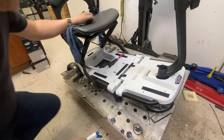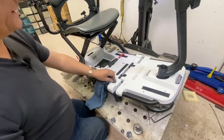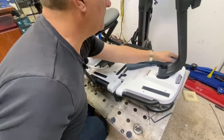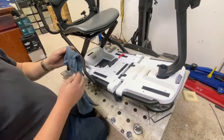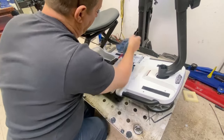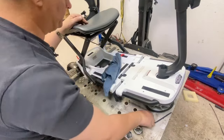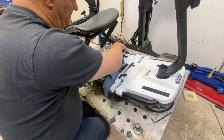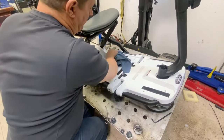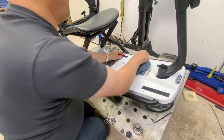I suppose you could do it in a larger scooter as well. I know you can increase the Victory 10s, or the Colts, I think they call them in Europe. You can get 35 standard when you order it, or you can upgrade to 40 amp hour. And to be honest, I would recommend 40 amp hour just to get that extra length of time on it. And the 40s seem to last a lot longer than 35s. We change one or two 35s a year in scooters that are a couple of 3 years old, something like that. Not very often, but power chairs, they tend to last 3, 4, 5 years. The 35 amp hour, not many 55s and 75s every now and again, but not very often.